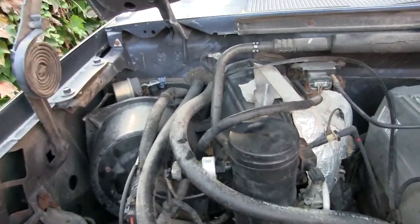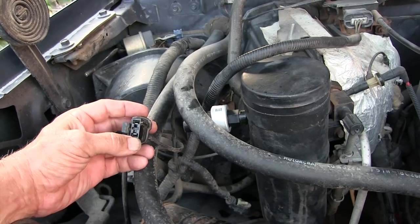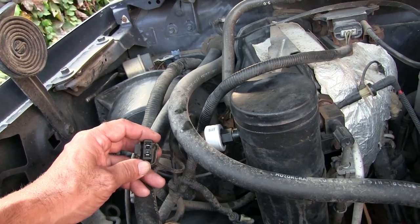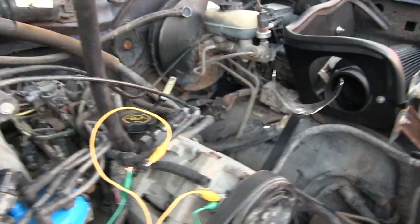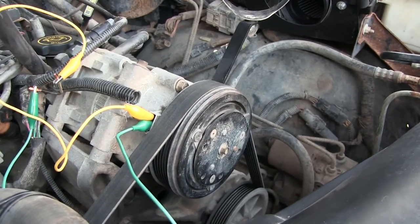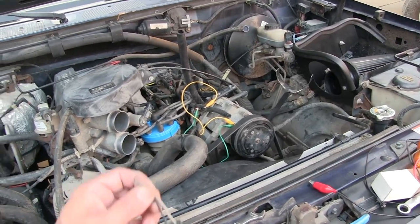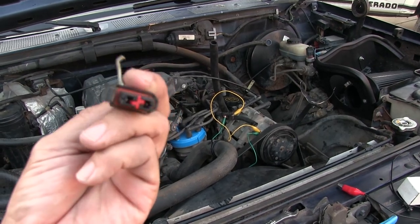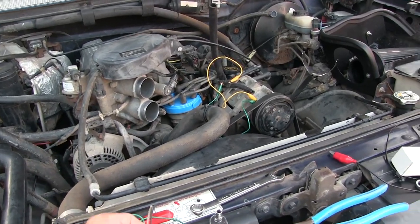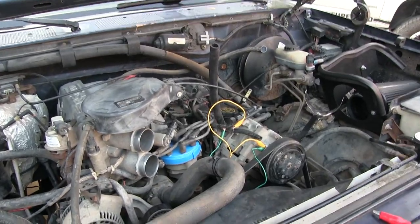What you do — just to check this out — is short these two wires together and see what happens. Cut a little piece of wire, a little jumper wire, stick it in there and loop it, and it should activate the clutch without the engine running. Now I know it definitely needs a charge, and I need to put the connector back on. I thought I had a bad wire or a bad connector — that's why I cut it off. Should have looked at the obvious, but I got thrown off using this tester, because I didn't have enough power — it would glow, but not bright, like on the battery.